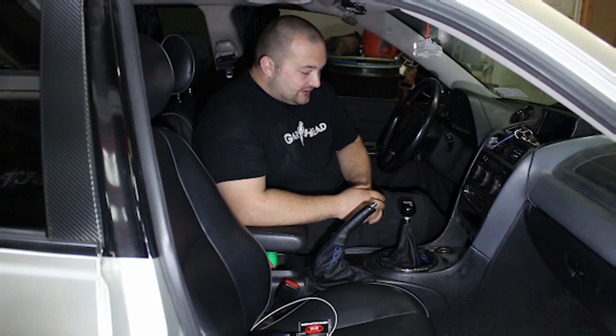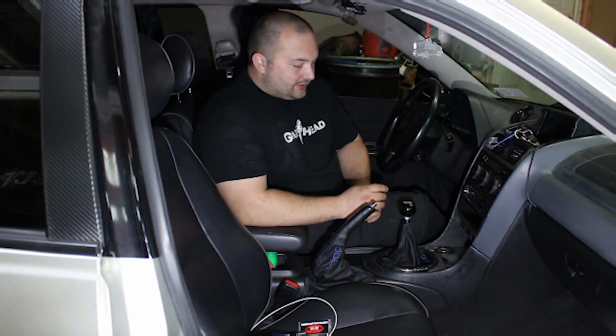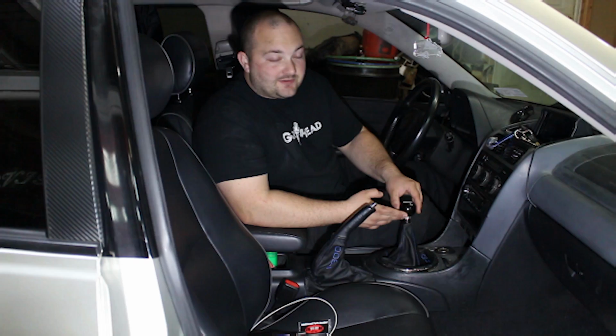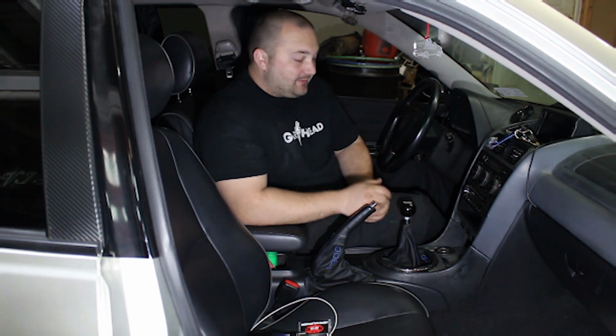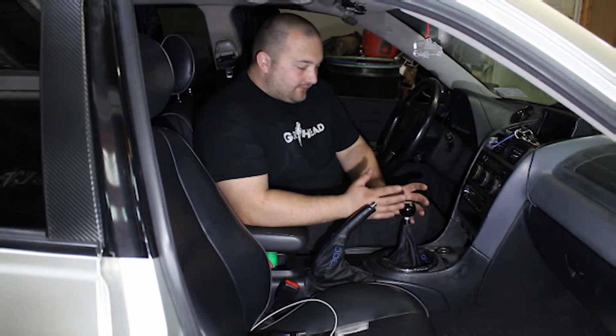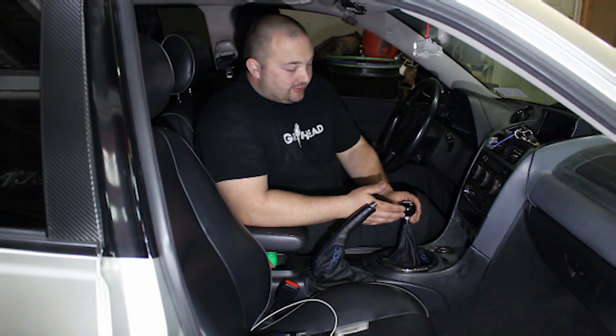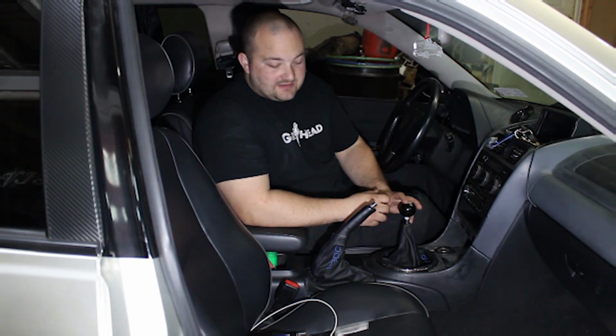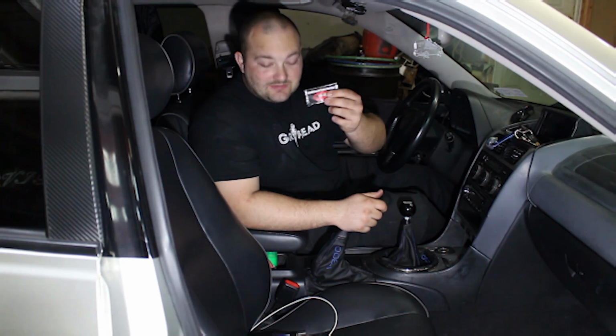I didn't even really notice an issue, but they discovered that with that revision, there was a slight amount of play in the shifter up and down, which I didn't even pick up on, but you can pull up and down on the shifter a little bit, maybe like a millimeter at most, and they weren't happy with that. So then they made another revision and sent me the revision this time, and this is now a Shim Kit, because for whatever reason there are different variances in this shifter housing. Not all shifters are the same, so they were finding that with some of their customers they were having absolutely no play, but some customers were having more or a little bit less play. So it was a little different across the board, but they wanted to make sure that everyone had, you know, the perfect setup.